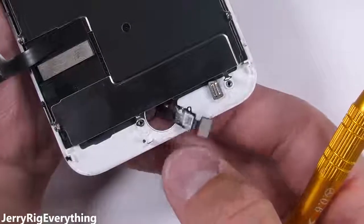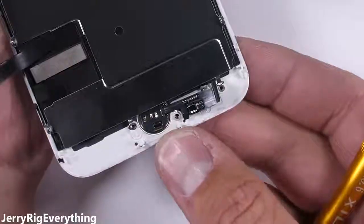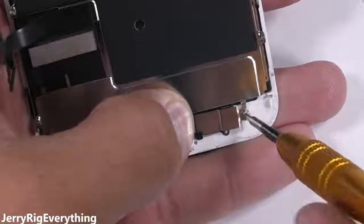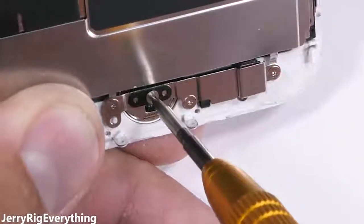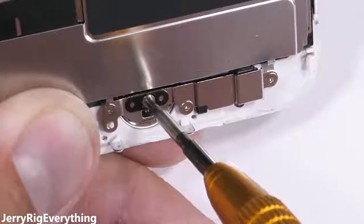After that, grab the finicky home button and push it through the front side of the screen, aligning the ribbon up with the screw holes and the pin on the frame. The metal plate goes on top of the home button, and the 3 screws around the edge are fine. But it's important not to torque down the center home button screw too far. Don't even make it tight. It needs to be snug and firm, of course, but screw it in too tight and the home button might not work anymore. So be careful.